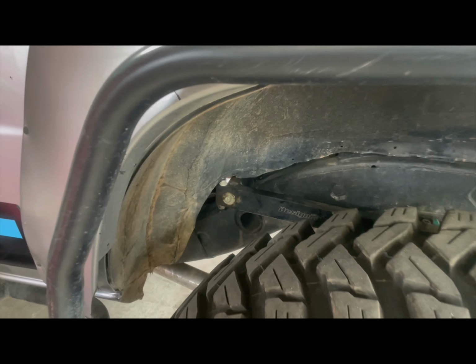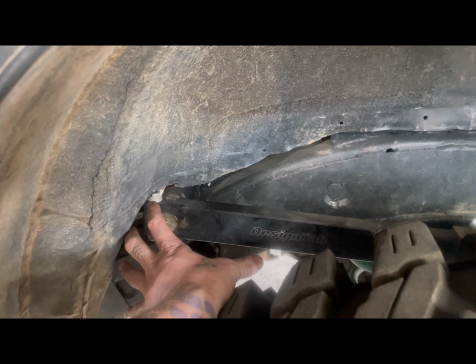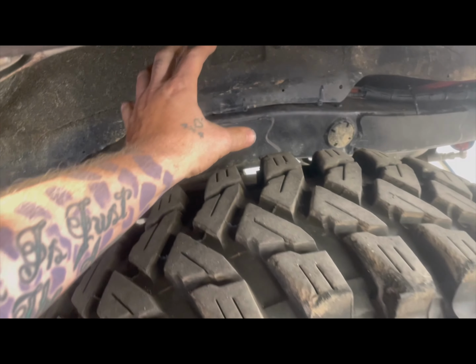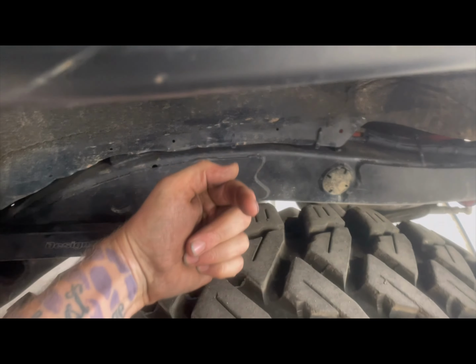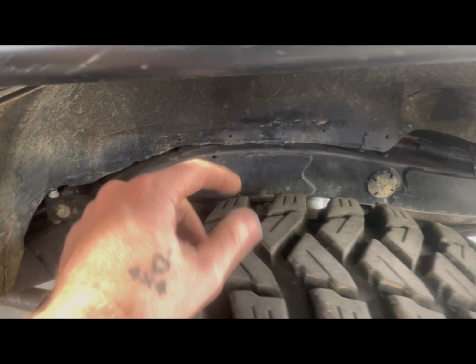So one thing we are doing with this bad boy, we're going to lob this chassis somewhere around where the sway bar lands. The whole idea is that is going to go in and then back to mount these new coilovers as far out as possible. That is absolutely key to make sure a car performs the way it should. Give it the best chance to do its job by putting it in the right spot.